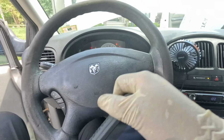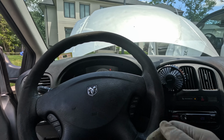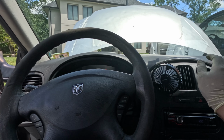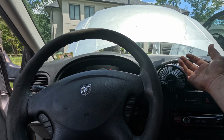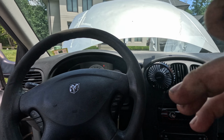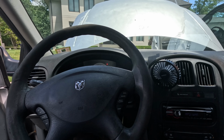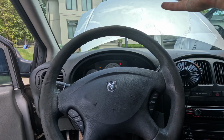Alright, starts right up. Alright, still not AC yet. Now it's AC. Alright, AC's working. That's it. We're good to go. Alright, so it was a blown fuse to the compressor, which might come back, might happen again. I'm not worrying about that now, but mainly just bad terminals.